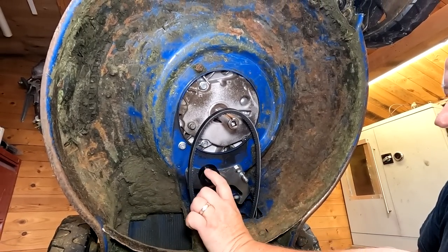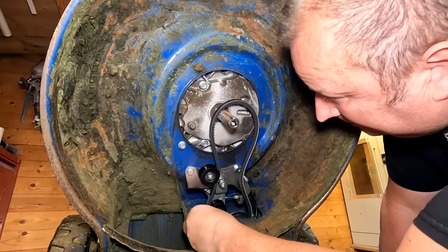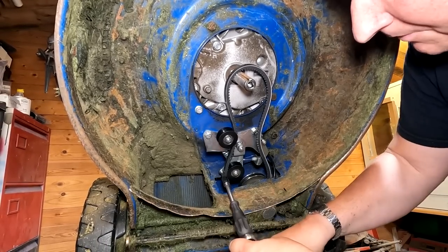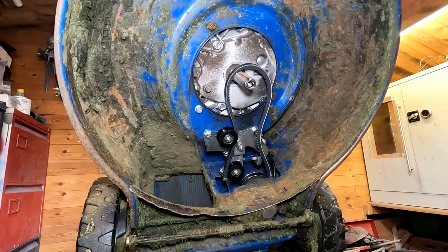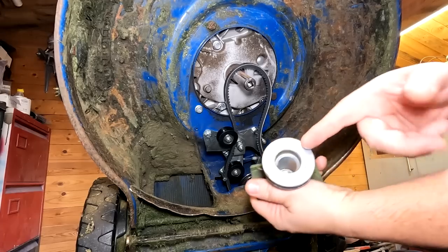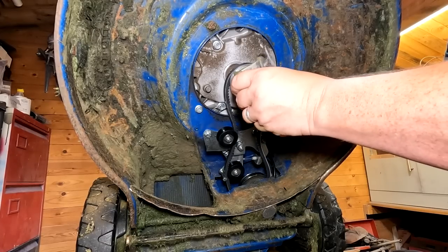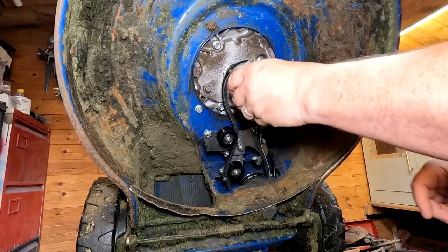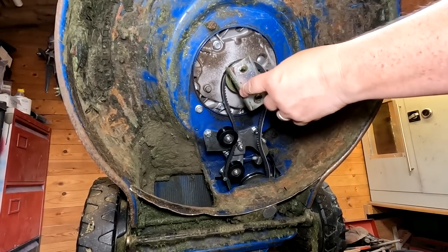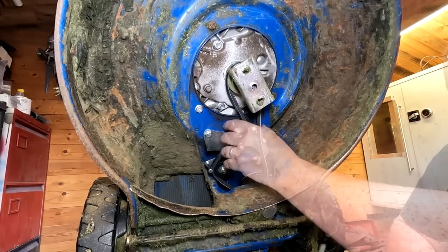The outer run here — not the pulley side, the outer run — it's just a straight run to the boss. So if I just do that back up now, because that belt's now in place. That's just a guide, you see. And if I get the woodruff key, put that back in the slot there, and then we can put the groove there that lines up with that woodruff key. I'll slide that on, put the belt over there like that, push that right home. Now to take the slack out, I'm just going to change the gear and put it in fourth gear.